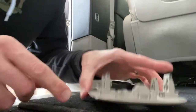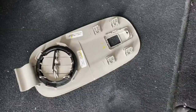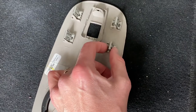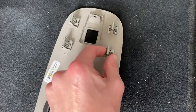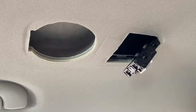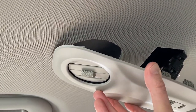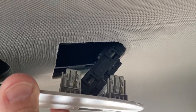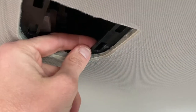Make sure they are flush with these plastic towers as shown. What I want to show you prior to repositioning this into place — on these actual clips, on each end are little compression tabs. If you can get your fingers up in that hole where the housing goes and compress these tension tabs, you can release this part a lot easier. I couldn't get my hand in there as it was too big for that hole. The backside I removed first — as I reposition this part in place I may shift that in and seat it, then use my other hand to align the plastic light housing, clip it into place, and shift this panel up into those inner slots. I'll need both hands and a bit of patience.